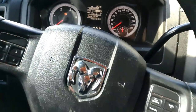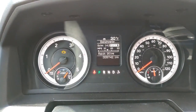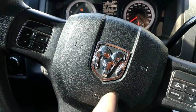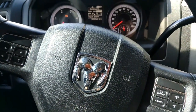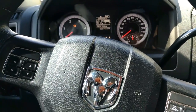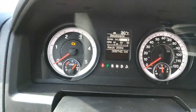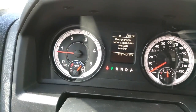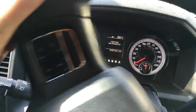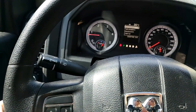You can calibrate it as I showed you earlier, then just install it back — so you will prevent all these further problems. How I got it calibrated: I have a friend with a professional scan tool. There's a gear that connects the clock spring with the sensor, and watching the gauge in the scan tool we just found zero degrees, then I put the clock spring back and reset the computer — no codes anymore. If I start the truck there's no codes, and as you can see I turn the steering wheel — nothing happens, no lights, and those switches are working. Thank you for watching guys, be safe.